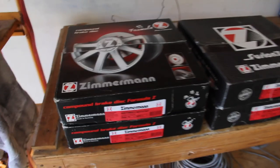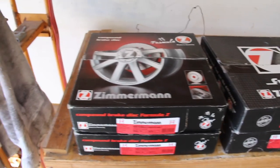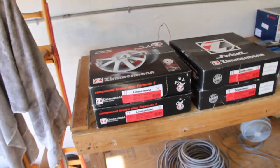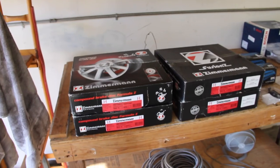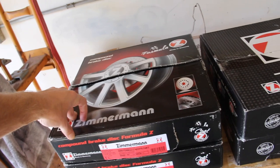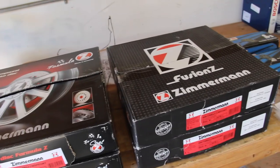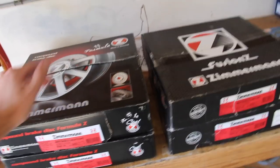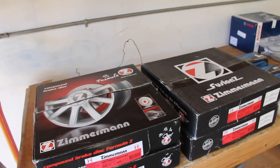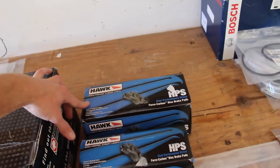Let's talk about some parts. We went with Zimmerman - they are cheaper than the genuine BMWs, and they make the genuine BMWs for BMW. So that's your call if you want to pay more for the genuines and get the logo on the barrel, or save your money and buy these. These guys came from ECS Tuning. They had a great deal on the Zimmermans compared to most anyone else. Search ECS for the standard BMW part number for the rotors and it will show you these. Check the description of this video for all of the part numbers. So you'll need two front rotors, two rear rotors, pads of your choice. We're going back with the Hawk HPS. Everybody says they squeak - sometimes they do, sometimes they don't.